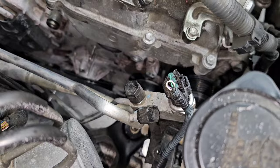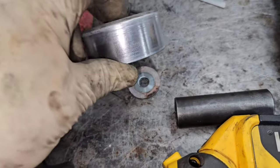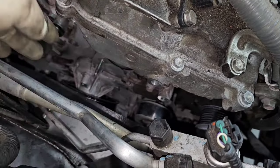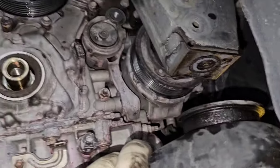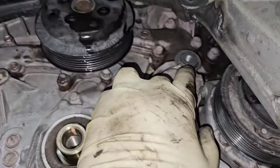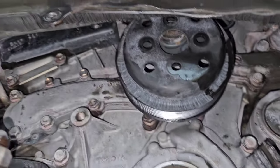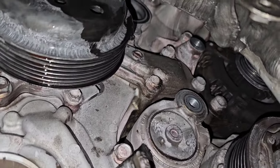With that idler out of the way — it was just a 14-millimeter bolt, came right out — just be mindful there's a washer on the back side of it that fell and hit the floor. When you're putting it back together, don't forget to put that washer in place; a little assembly lube will hold that to the pulley. Now you can see the backside of the water pump, which you couldn't see before because it was blocked by that pulley. The cradle's hanging down now and I've got a nice gap, but I still can't get the pulley off — not coming down far enough. I took the pulley off the tensioner; it's a reverse thread, so righty-loosey, lefty-tighty. Then I should be able to get to all the bolts on the pump itself.